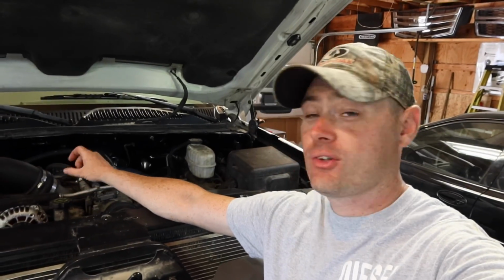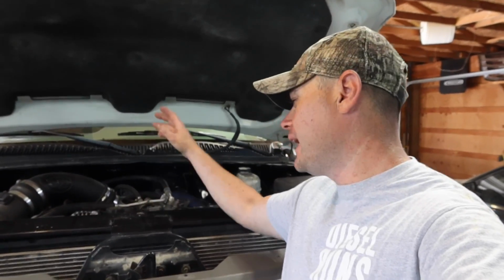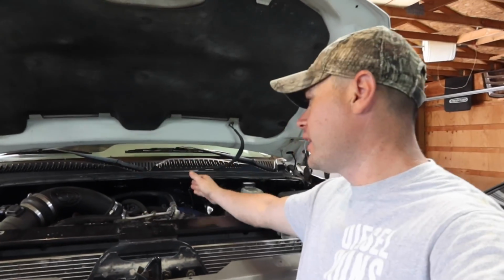I don't want to get off topic here, guys. This is the huge reason why I'm making this video. We can install a manifold, Edge CTS2 monitor, all that good stuff, and I'll show you guys how to do all that. But we have a giant charger. We have a 68mm Ryan's Diesel Service turbo, and this is a 6.6 liter. This is a first generation style Duramax, so this is your LB7. Not only that, we have fueling, guys. We have a 10mm Exergy CP3 pump, and we have 50 over injectors. We have the built trans, but guys, there's no tune on this truck.